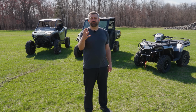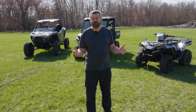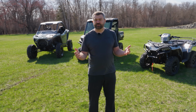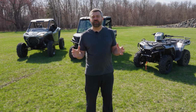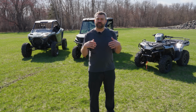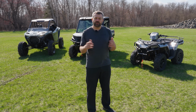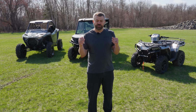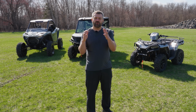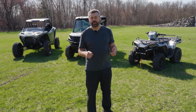All right, the fourth driveline mode that we want to talk about is active descent control, or ADC for short. This is available on select Ranger and Sportsman models only, and it's really great for hilly terrains where you're off the throttle and you want all four wheels to help backdrive the engine so you don't have to ride the brakes when you're going down those hills. So think about this in times where you have all-wheel drive engaged, but you also want the ability to go down those hills without having to ride the brake all the time.